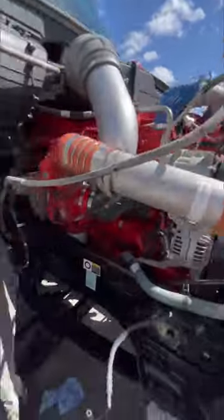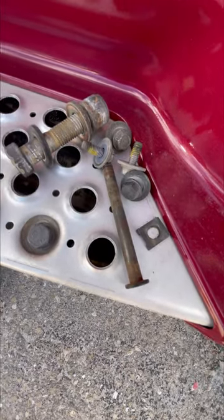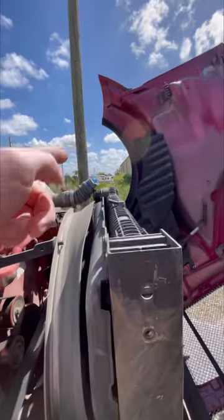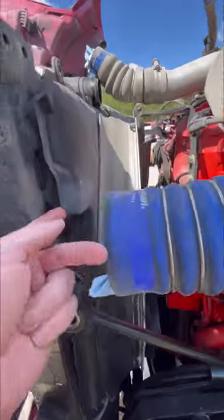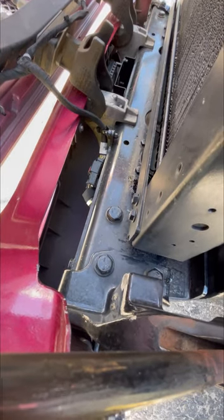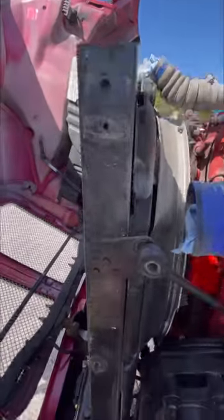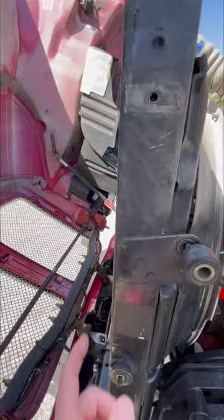I took the top off — to do that I had to take the pins and clips off, then four bolts on each side, and the top housing of the radiator comes out. Next step is to take those cross members out on each side — not the bottom ones. Then the last two bolts on the side come out, exactly the same on the other side. Radiator hoses are disconnected — the bottom one too — and then the radiator should come out.